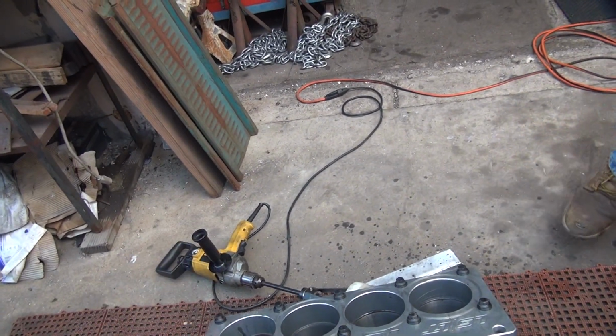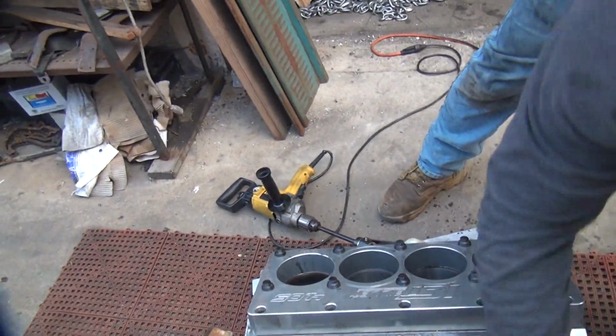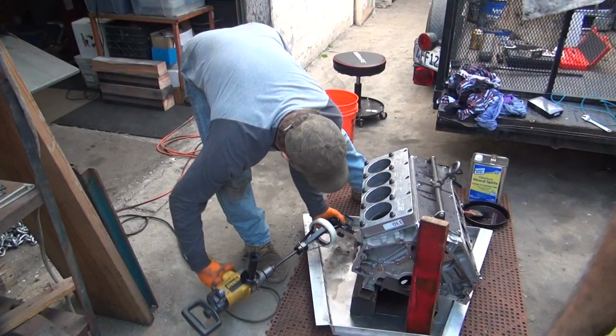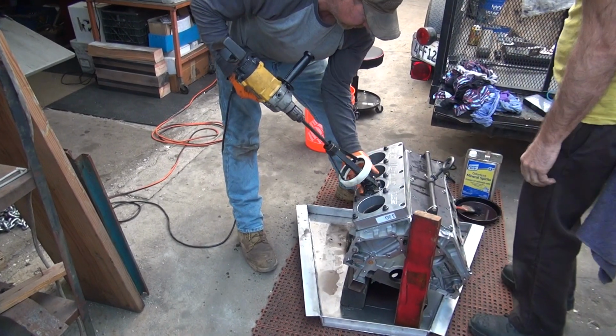The cylinder's out of round, so that 2.5 thou, it doesn't matter. It doesn't matter when it's 2 this way, it's still tight side to side. So you still got to do a lot at the bottom because we still got a lot of taper in there we got to get out. And the bad part about a car block is I can't turn the cylinder hole around and screw up the stones because they take wear.